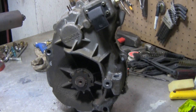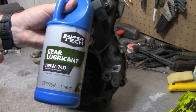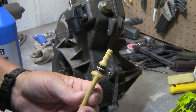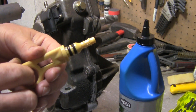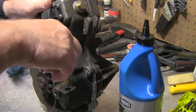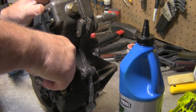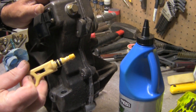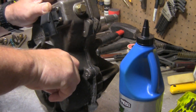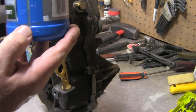I'm going to go ahead and fill it with oil — I'm putting 85W-140 in it. When I put the gear oil in, I want it to be between these two marks right here. Remember, in between these two marks is our safe area. Put the dipstick down in there, make sure the transmission is level, then pull it back out.